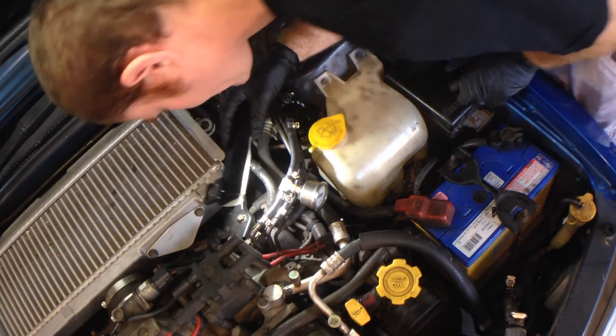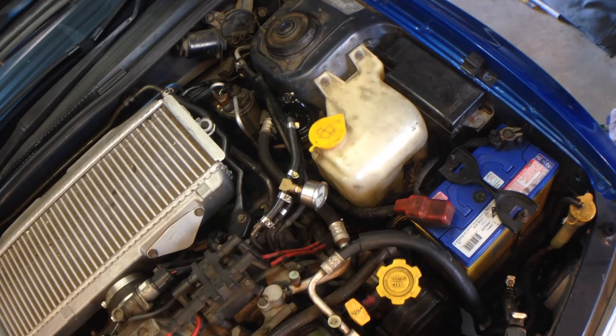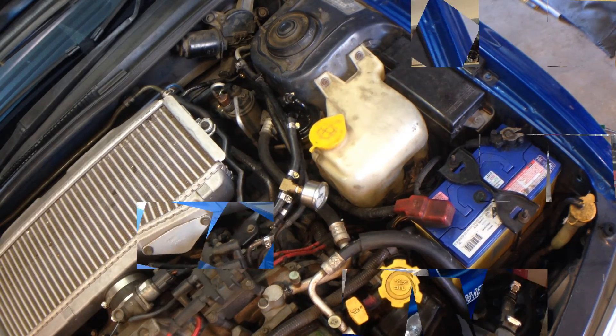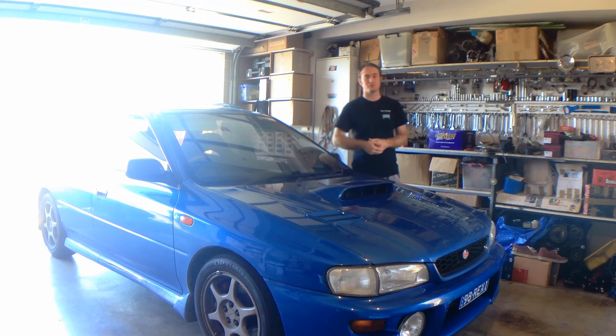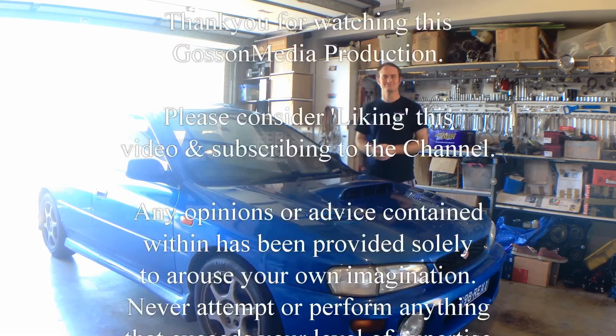Let's just have a final leak check now that it's been run — all good. So that's the job essentially finished guys. That's our new fuel filter fitted on our Subaru. As I mentioned before, this guide is pretty much useful to all Subarus powered by the EJ engine up until mid-2005, if they've got that shape fuel filter in the engine bay — it's got to be the same deal. It's a simple job, there's no excuse for not performing this maintenance. You should do it every 20,000 to 40,000 kilometres, depending on whether you're pumping from a good petrol station or not. As always, thank you for liking, sharing and subscribing. Please tune in next time on Nav's Garage. Hooroo!